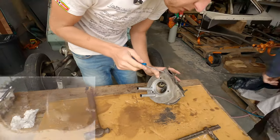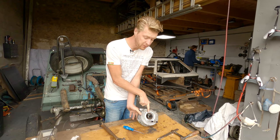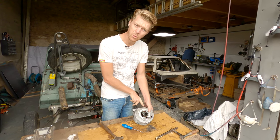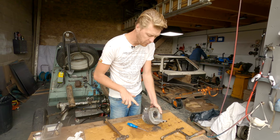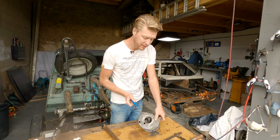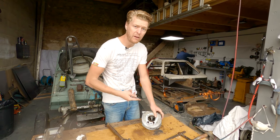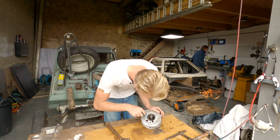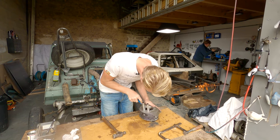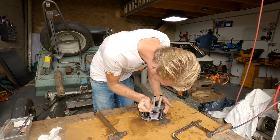Ford has also had carbon buildup problems. It used to be a big problem with direct injection engines, where they directly inject fuel into the cylinder. The fuel injector is kind of where the spark plug is here, and it squirts the fuel straight in, rather than squirting the fuel on the back of the intake valve. Modern direct injection engines have one injector in the cylinder and one on the back of the valve, so that it washes all the carbon off the valve and helps to prevent it. Still a thing, but it's not as bad of a thing.